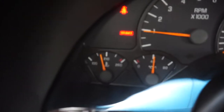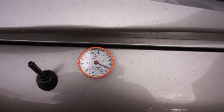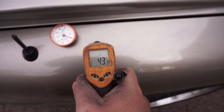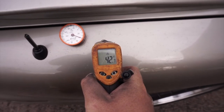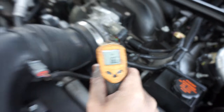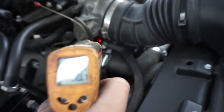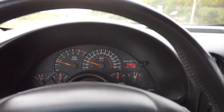We made it to the first stop — this is where we turn around. The temperature gauge is sitting around 180–190. Outside taking measurements with the thermal gun: ambient reads around 40–43 degrees, throttle body measures about 68–74 degrees on each side. On the cooling line it's reading 100 degrees. So all the way down there right on the line — 100 degrees. We've got another 12 miles to go back and take our second measurements.